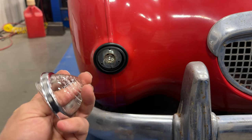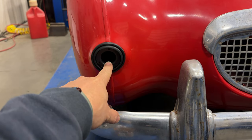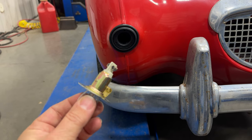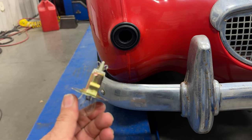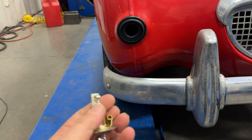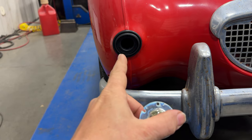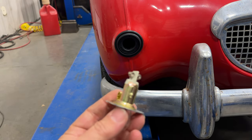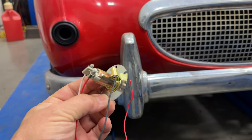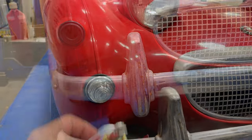Normally the wire harness would have bullet connectors that you could stick through here and then connect up to this, but those have been cut off of the wiring. So I'll need to make some new wires with bullet connectors that connect onto these three positions, then stick them through there and connect them to the wire harness where they're broken. I've attached three wires to it now, I just need to feed the other ends through the grommet — there we go.